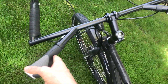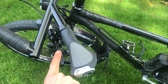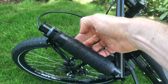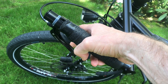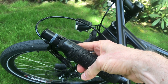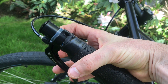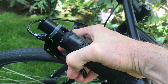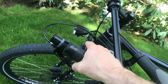These mountain levers here — this is just conventional stuff. The cable starts here, and then it goes out and it hits this, which is what they call a cross-style lever or an intermediate interrupter style mountain brake lever. You see them on cyclocross bikes, and they work not by making the cables shorter, but by making the housing longer. So both of these work on the same disc brake down there.